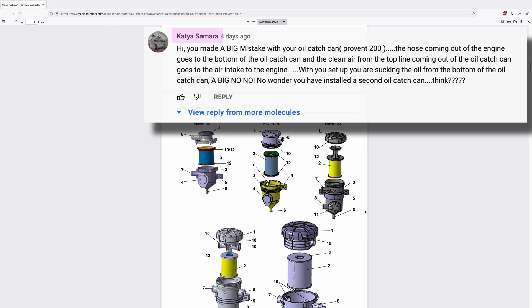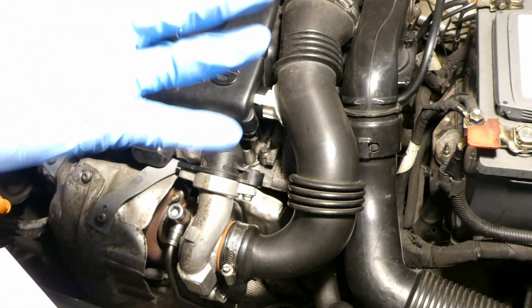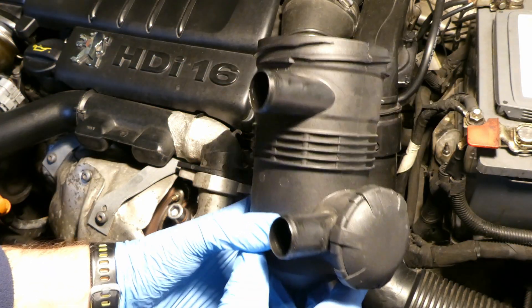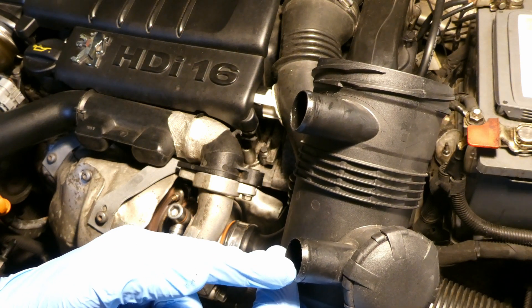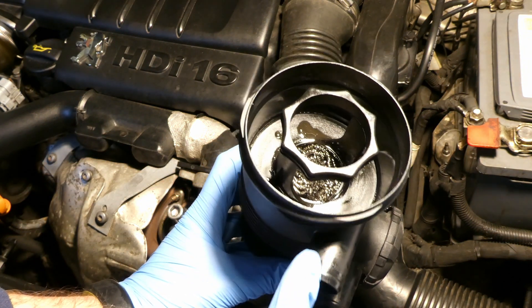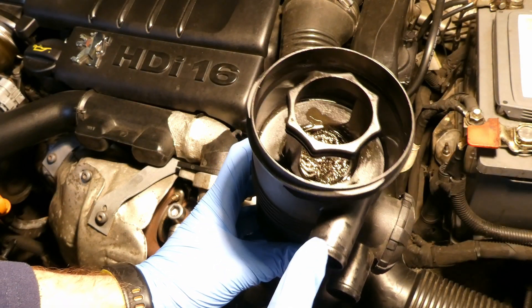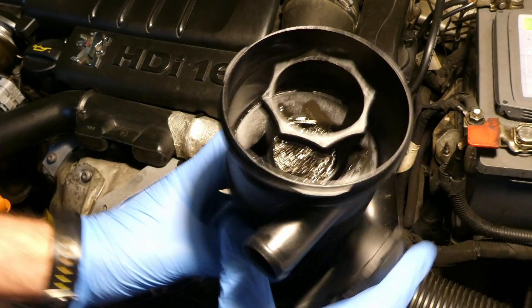I've received this comment on several occasions, so let's think about why the inlet should be at the top and the outlet at the bottom. The top is the inlet port and the bottom is the outlet port. The design is rather specific - the opening at the top is offset slightly to the right, not centered. This is intentional: the gases from the crankcase carrying oil vapor go in and start a circular motion around the edges of the wall of the oil catch can, then eventually come down to the paper filter element.